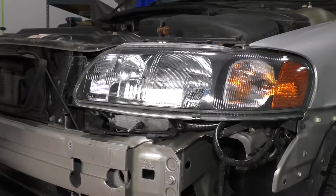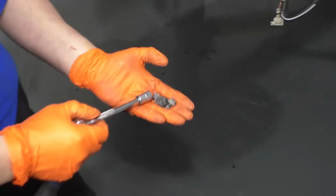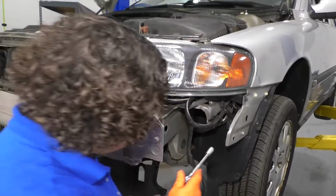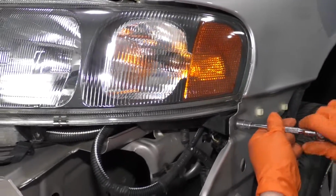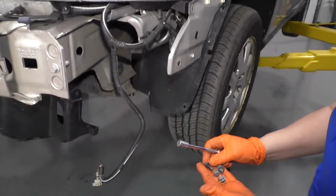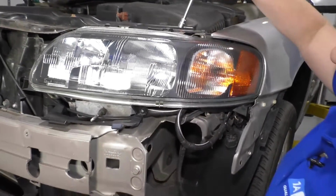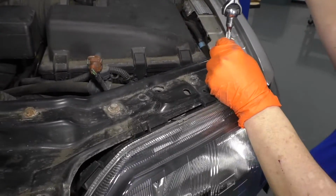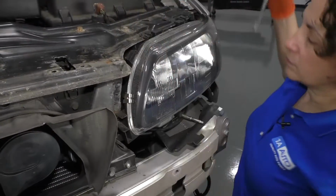So I do see a size difference here, and there's a washer difference. So I'm going to use the 2 ones with the big washers. Those were on that mounting piece. And this one without the big washer goes to the edge. Let's see what we get. So that looks like a longer bolt. So we know the longer bolts go on the outside. And let's see what we get up here. Yep.